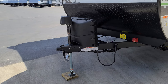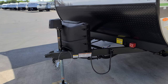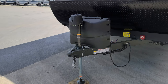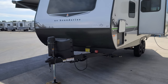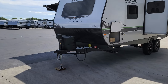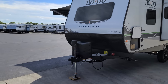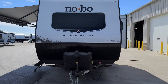There's a power tongue jack with a manual override, and a light built into the jack in case of electronic failure. Two 20-pound propane tanks with an auto-changeover regulator below the bottle cover. The hitch ball is 2 and 5/16 inches with heavy-duty safety chains and a breakaway cable — all the necessary safety equipment. Depending on your tow vehicle, you might also want to talk about getting a weight distribution system — Blue Ox and Equalizer E4 are popular ones. There's also a lower metal diamond plate across the front.